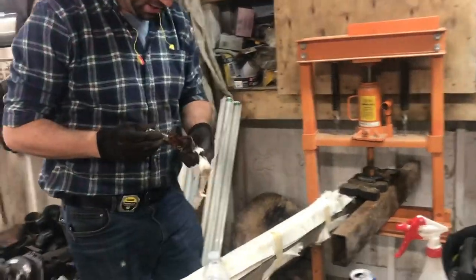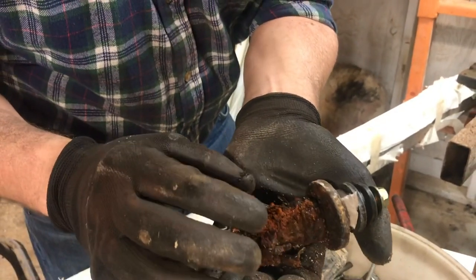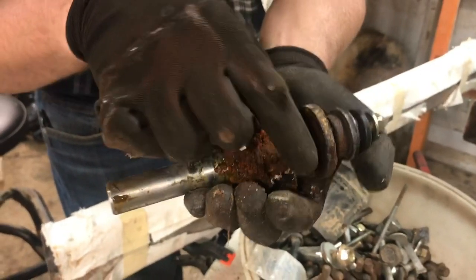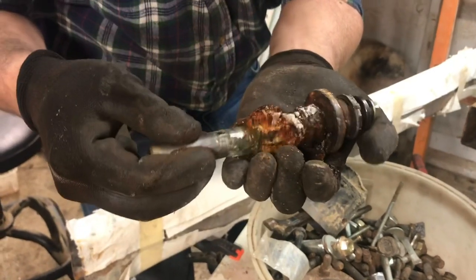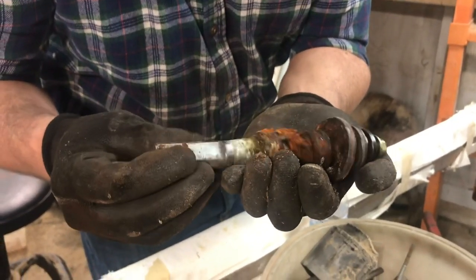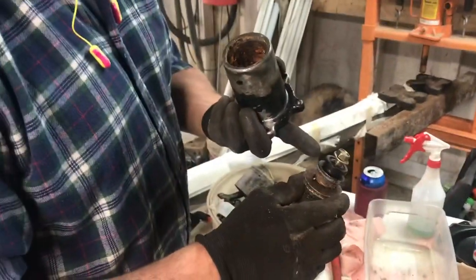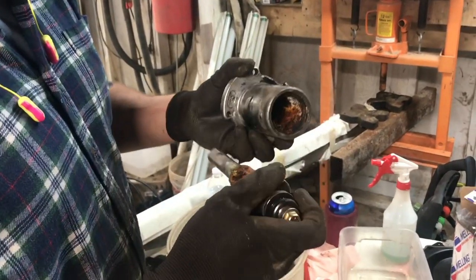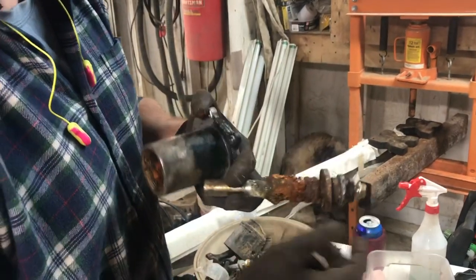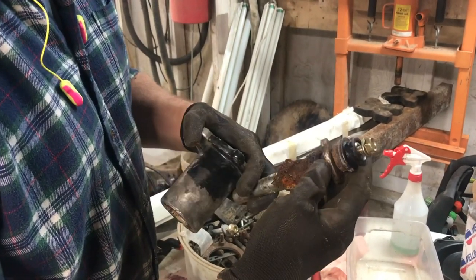There was no saving this — I definitely needed a new one. Holy crap, that bearing was gone. That used to be a bearing? I think this used to be a bearing. Yeah, that's a race — where ball bearings are supposed to ride inside. I can't even see the shaft. So I guess what's supposed to happen is when you pull the pulley off, there's even a snap ring in here that's supposed to come off before the whole thing gets pushed out. This was so corroded away — there are actually two bearing races, one and two — both of those are gone. Nasty.